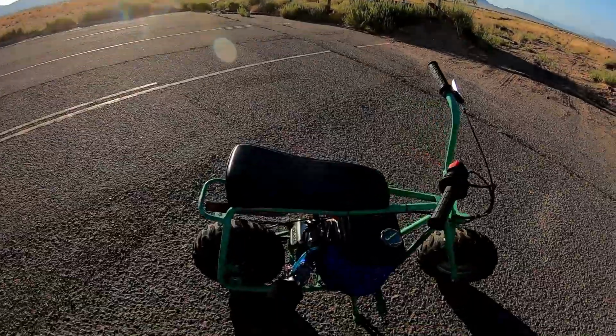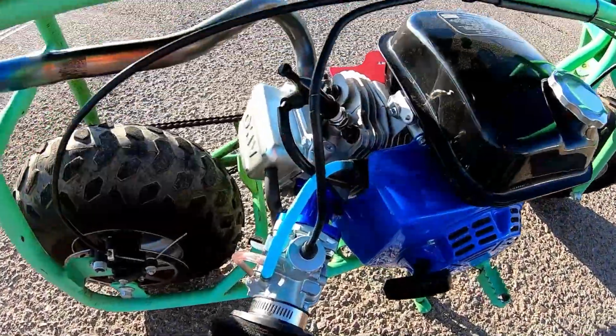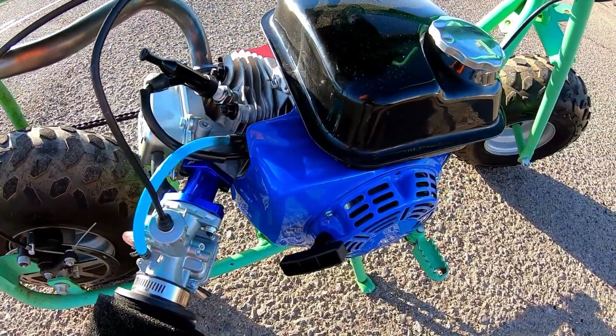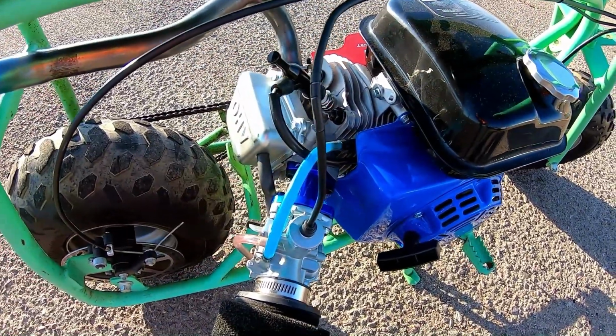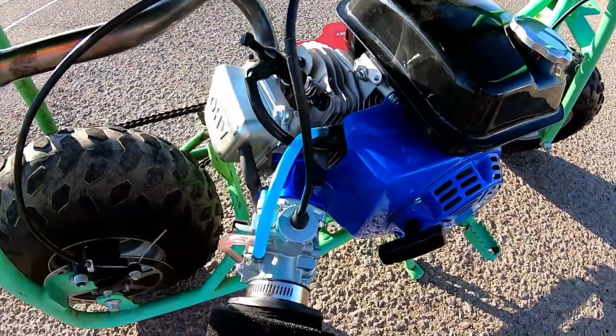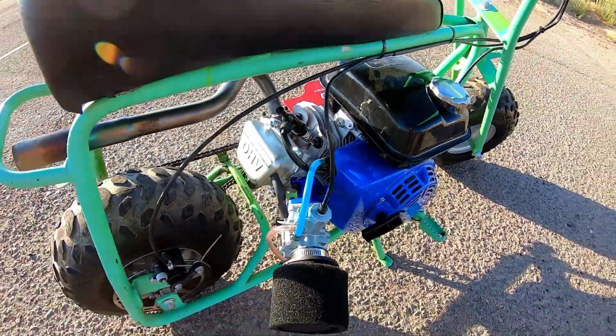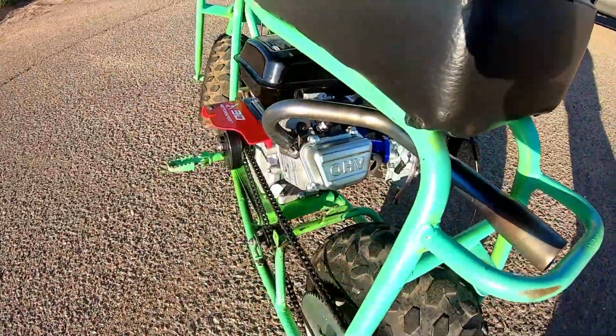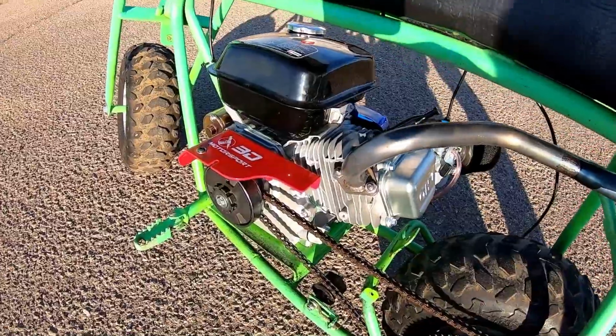So I'm gonna have to go ahead and get some shims and put those valve springs in there. Because you could hear it, it was turning a lot of RPMs. I don't know what it was turning, but it sounded like it floated the valves at 54 miles per hour. So yeah, that cam definitely is an improvement over the stock cam for sure. I just need to change up the valve springs so it's not limited by the valve springs. And then we'll have to come out and do it again.